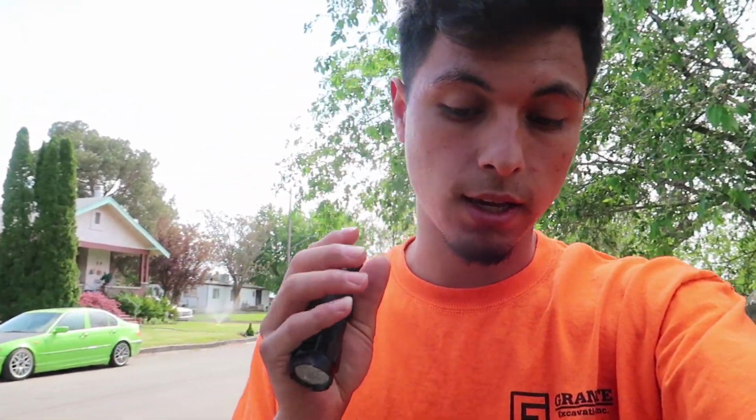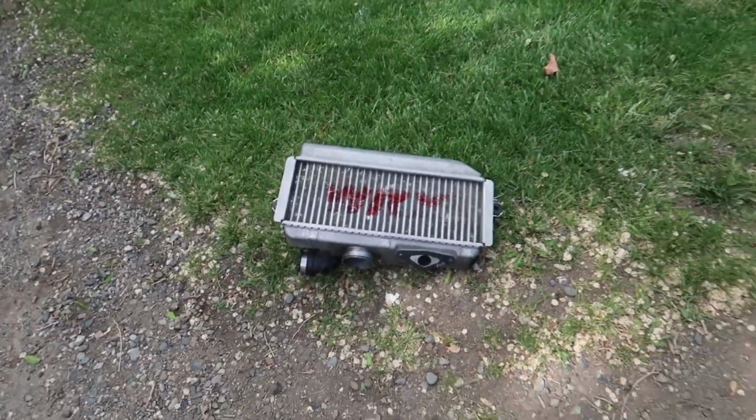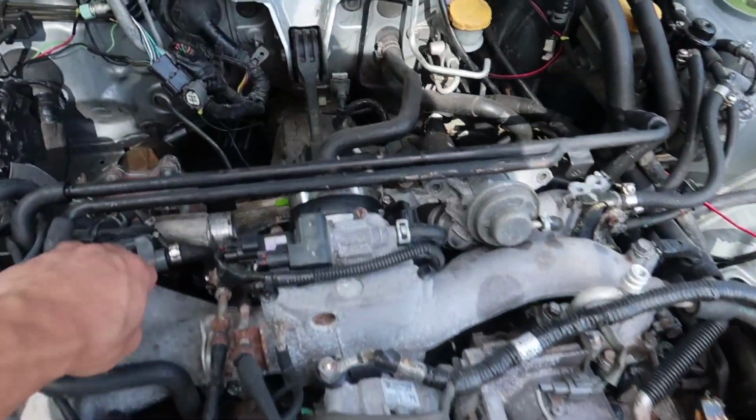So I was low on coolant again, and that's the only place that I've seen the black light pick up any dye from. I've looked around the whole rest of the engine bay, nothing else was wet. So I'm going to check and see what's going on under the intercooler. I know there's a hose down there, it might be ripped. Let me pull off the intercooler and then we'll get to working on modifying the blowoff valve and that coolant leak. Intercooler is off. Check out what was leaking.